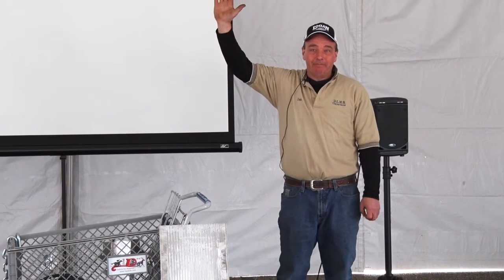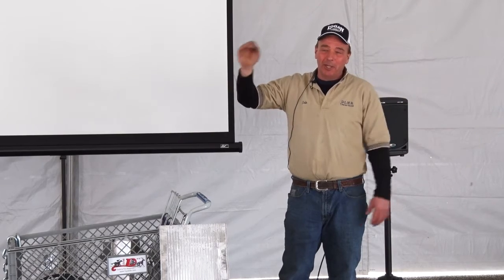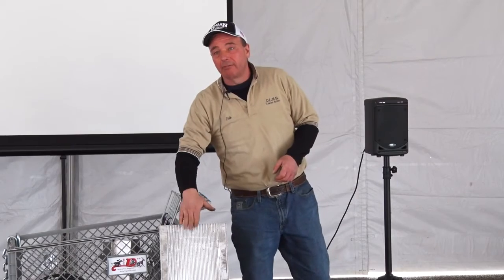I have. Coming back from the Outer Banks with me and my wife. We were coming back from our 2 weeks vacation, and we thought it was paint. You know how paint hits the road? You see, it wasn't. We crested the hill, and there was a gentleman on the side of the road with this horse trailer, and I could not believe how much blood was out. My wife wanted to stop, and I'm going, there's no point, that horse is done. And it happens more than 14 times a year. Horses go through floors because you did not pull your mats out.